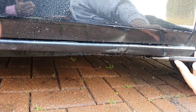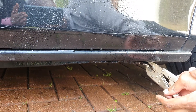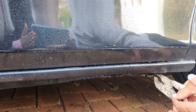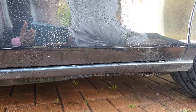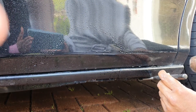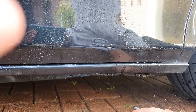This area is at too much of an angle to hit directly, so I'm going to use a set of mole grips to just divert it downwards to a better, more favorable angle. You can see how it's now starting to move down and then I'm able to hit it with those parallel-sided punches. You can see it's now starting to be easy to manipulate and I'll be using these mole grips to do that several times.